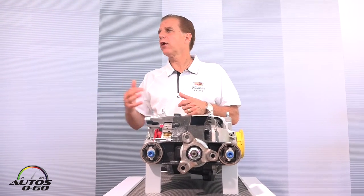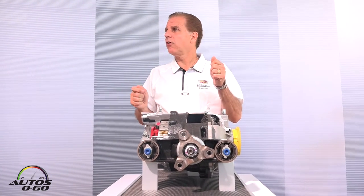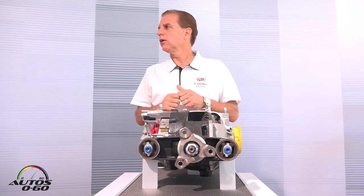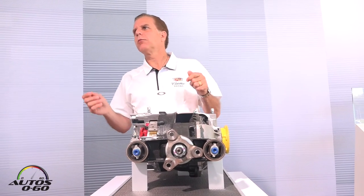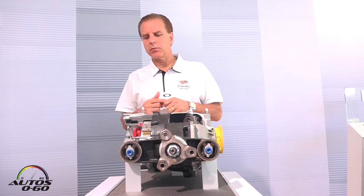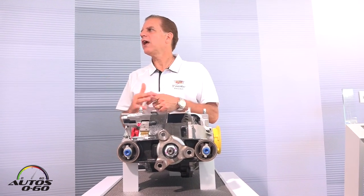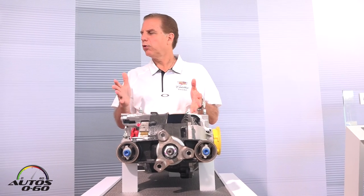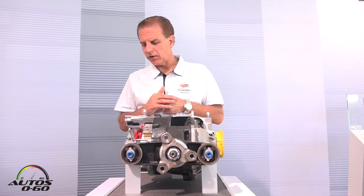This helps steering response for light steering maneuvers, and for more aggressive maneuvers when you lift off, we're able to transfer torque to the opposite wheel so we can get maximum acceleration. It allows you to exit a corner at speeds you wouldn't have otherwise, because we can put the torque where it needs to be — putting it to the tire that's on the ground with the greatest contact patch force.